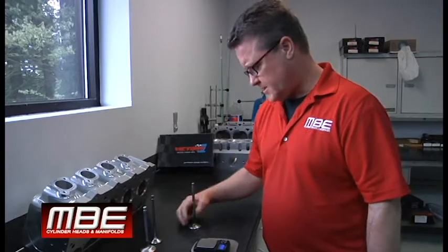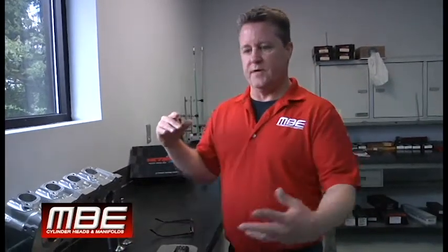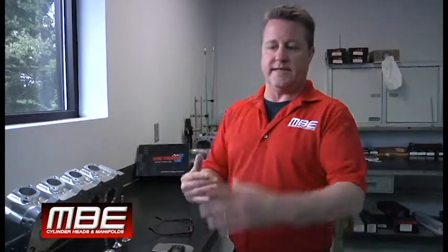A lot of nitrous guys still want to use an Inconel valve, but what we explain to them is: if you look at a 958 cubic inch big nitrous motor that runs PDRA or NHRA Pro Mod, they run about 1,700 horsepower of nitrous — basically double what the engine makes — and they do not run methanol, but they run titanium exhaust valves and they live. We're trying to teach our customers that even with nitrous you don't have to run an Inconel valve. If the valve is designed correctly — putting the two-degree hub on it — it will dissipate the heat and it saves your lifters, your valve springs, your camshaft, and all of those parts. That's why it's important in the right application to use titanium whenever you possibly can.